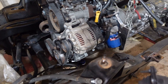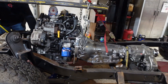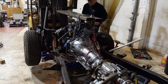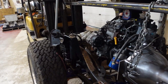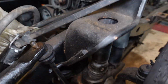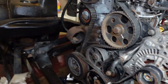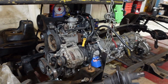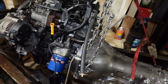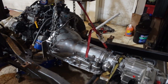Now we're getting this thing where it should be. We have the angle of the motor set back a little bit and the transfer case marked where we had it last time — so that's pretty much where it's going to live. That looks a lot better clearance-wise, plenty of room, and we're right on the bump stop at full compression, so we've got plenty of room for the engine. We were worried about the oil filter access, but it looks like we should be able to get it from underneath perfectly. It looks a lot better than it did with the air conditioning compressor in there.